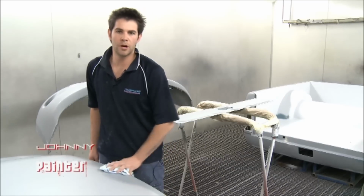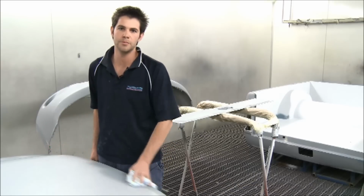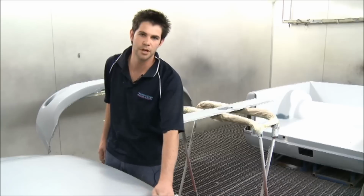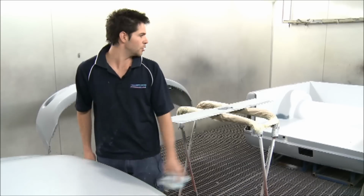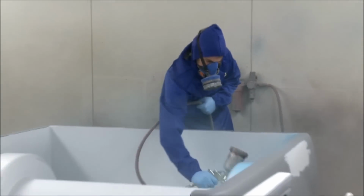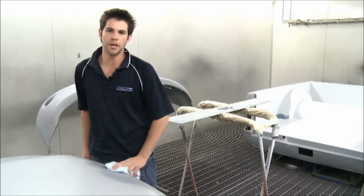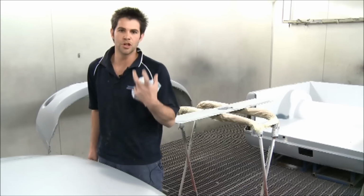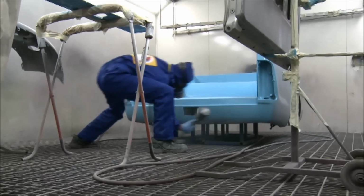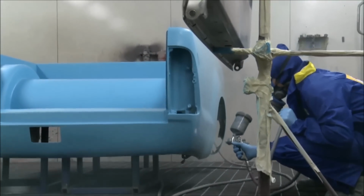All right, we've rubbed down all the panels here. We're going to prep-sol them all, which takes all the contaminants off them so they're ready to paint. Then we're going to blow the car down, all the panels, which allows it to have less dirt in it. Then we're going to start putting a base coat down. After we put the base coat down, we'll scuff it down. That allows less dirt underneath the pearl coat, because if it's under the pearl, you will then end up with the dirt showing up a lot more because the pearl sits on top of each piece of dirt. Then we'll put some more base coat down. Then we'll put the pearl on and finish it off with a clear coat. That will be the process to paint all these panels.